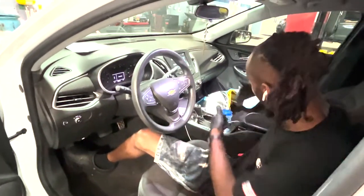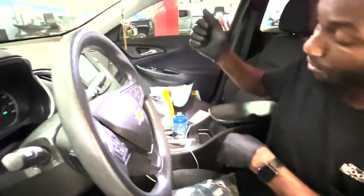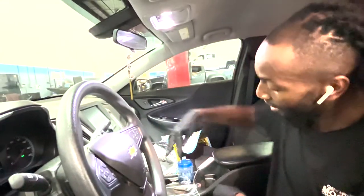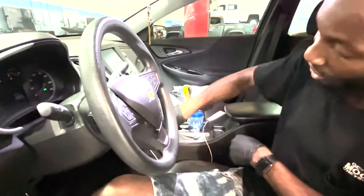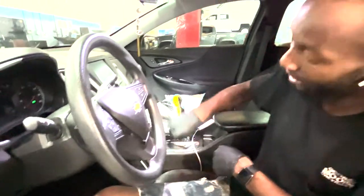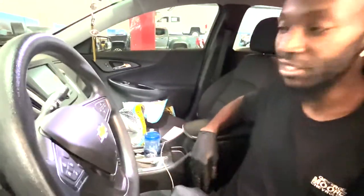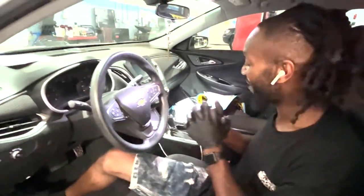With that, the center console must come up, the shifter knob must come all the way off, and then once you have access to everything inside, it's going to be three plugs, one plug, and four bolts that hold down the shifter. You remove the shifter and the shifter linkage with hex keys, put the new shifter in, and do it in reverse order. Reset the PCM, and it's back to where it needs to be.